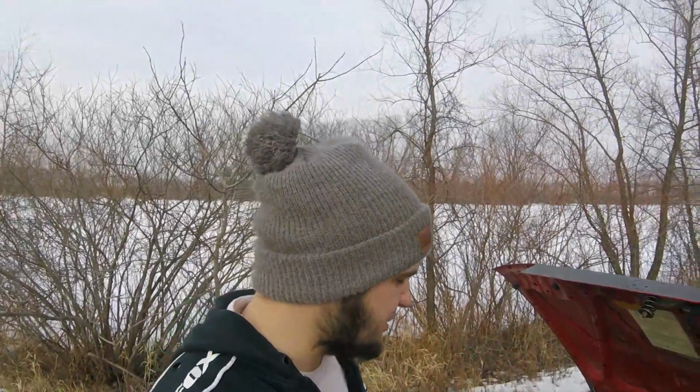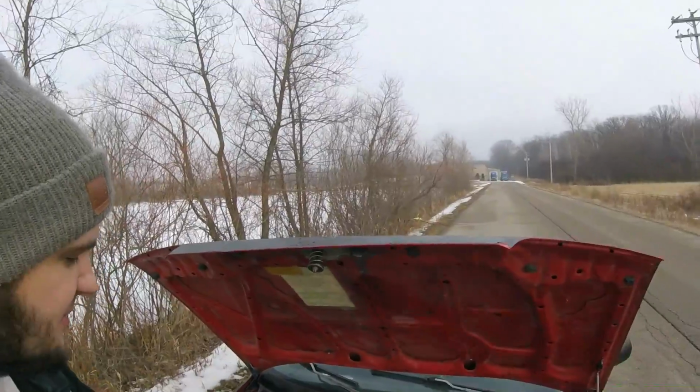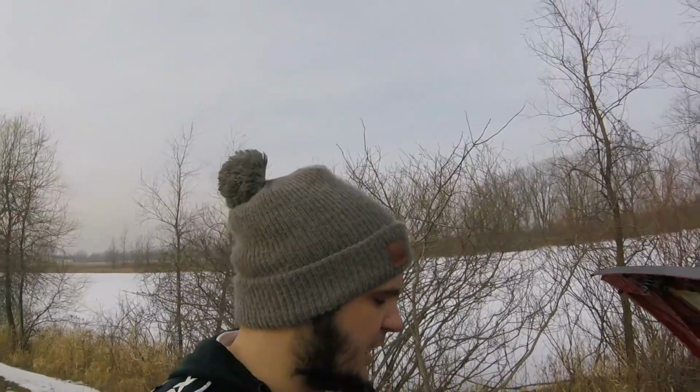Now today I've had the car out and I've done like 3 or 4 pulls, and now that I've shut the bypass valve completely, new belts, everything, it seems to be above 10 pounds no matter where I am. So it seems to be working good.